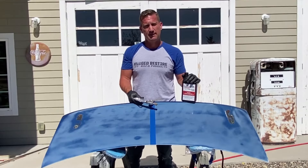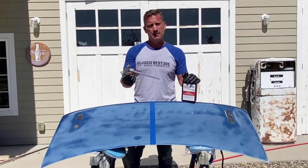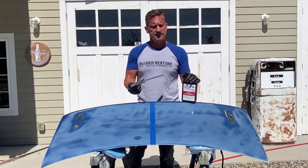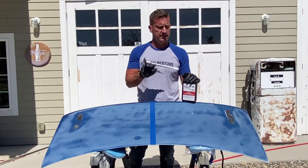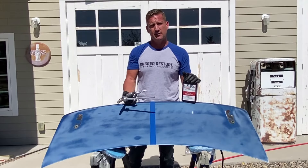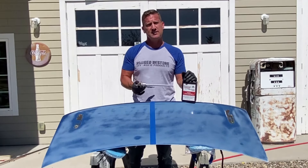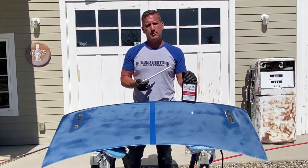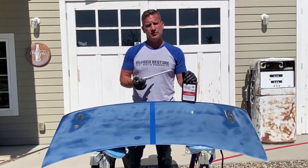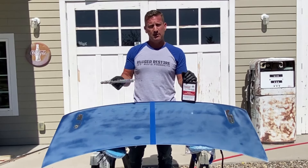One of the cool things about Barricade sprayable bed liner is, of course, that it's sprayable. This is our R88 spray gun that you can purchase separately, or you can roll it on or brush it on as well. This system has been specifically designed to work together so the threads on this gun fit perfectly on the top of this bottle. So all you have to do is literally pull the cap off, put the gun in, and you're ready to go. You want to dial in the spray gun so it matches the pattern and thickness you're going to want — just take a separate piece of cardboard and adjust your air pressure and the nozzle to get the pattern and texture you want. This gun is ready to go, so all we have to do is insert it and we're going to spray.